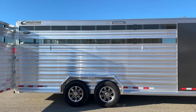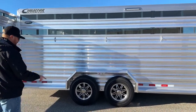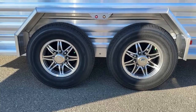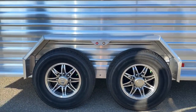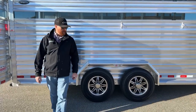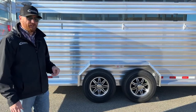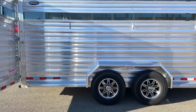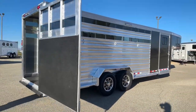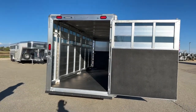You've got three exterior tie rings on this trailer — we can add more anywhere there's an upright post. We have two 7,000-pound Dexter rubber torsion axles with electric brakes. We opted for black with silver rims on this one — 16-inch — balanced and nitrogen-filled tires. The one-year no-questions-asked tire warranty means that if you catch road debris, have a blowout, or catch a nail that can't be patched, they'll send you a new tire. That's through Lion's Head, the vendor Cimarron uses for wheels and tires. You also have two years of roadside assistance. Those nitrogen-filled tires — you can put air to them, but you won't get the nitrogen benefit. If you have a slow leak, we recommend having a tire store put nitrogen back in them, as it won't allow PSI levels to fluctuate as drastically as air.